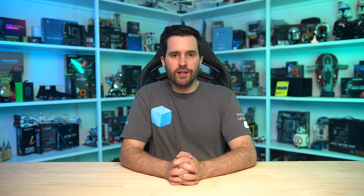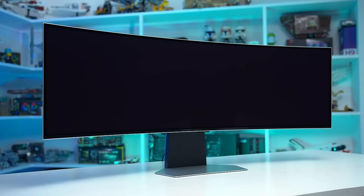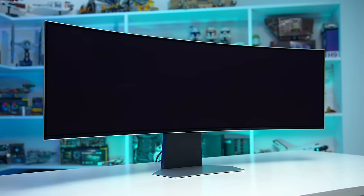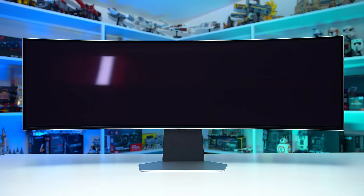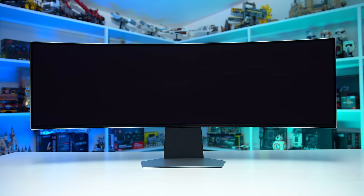I believe text clarity of second-gen QD OLED is much better than similar W OLED panels, so of the two main OLED technologies I would choose QD OLED for anything text-heavy. Unfortunately, the screen composition, layer structure, and coating has only received minor improvements relative to first-gen QD OLED. This second-gen panel is still glossy and still has issues reflecting ambient light when light sources are in front of the display. The layer structure reflects far too much ambient light — in a non-optimized environment this makes the panel appear grey even when attempting to display pure black, reducing the quality of OLED's deep blacks. The second-gen design does reflect a bit less ambient light, but the improvement is not enough to be considered a fix.